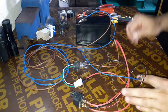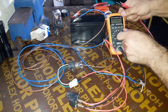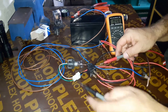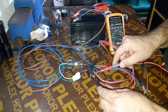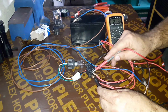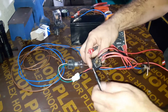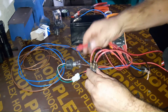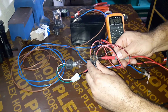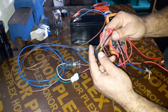Let's check the voltage with a multimeter to make sure we have 12 volts and all circuits are okay. First, checking the relay control side — there is 12 volts, which is okay. Pin 30, the relay feeding side, should have 12 volts — and there is 12 volts. Now checking the relay output at pin 87 — there is no voltage at all. This confirms a faulty relay.